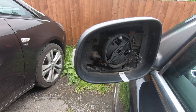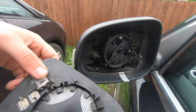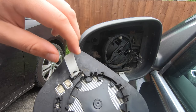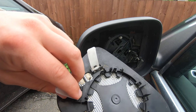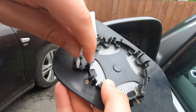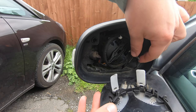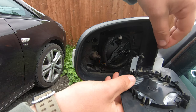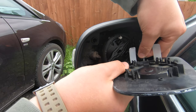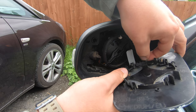So here we've got our flap that came disconnected. I'm going to slot it back in — these are essentially little guidance flaps, they don't really do much to be honest, they hold the mirror in place. I'm going to clip this one back into its housing. This one made it on a 5,000 mile trip to Sweden and back, so it hasn't been an issue. Now we need to reconnect the mirror — you've got to do these in the right order otherwise the mirror won't heat, which is probably why it hasn't been working. Sliding on like this — there's one, there's two.